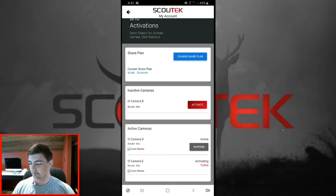One final thing to note: in the beginning, we turned our camera to setup mode to pull up the camera information screen to register the camera. At that point in time, the camera was not yet activated. Now, if your camera is showing as active and the camera remained turned on throughout the entire process, most likely you're going to need to power cycle your camera before it will begin working. So just turn the camera to off, give it a minute or two, and then turn it on — and from then on you should be good to go.